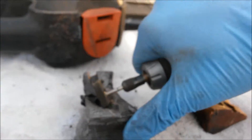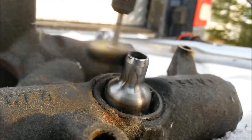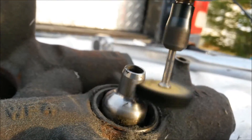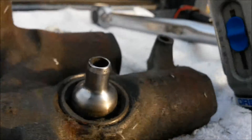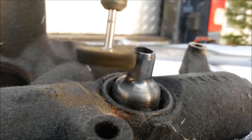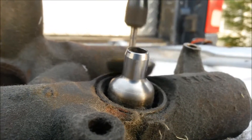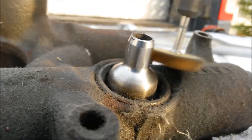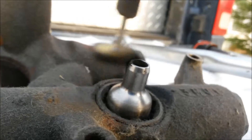We'll go to our next phase, which is our Tripoli. That's just like a slightly finer grit sandpaper. I'm not going to get those top grooves all the way out in this video. You want this stage to take just as long as your first stage, because you're getting out the larger cut marks and grooves from the first phase — it's going to take just as much time as the other one.